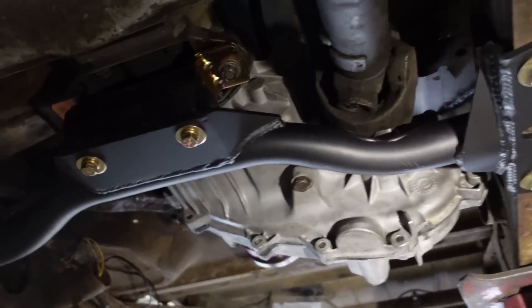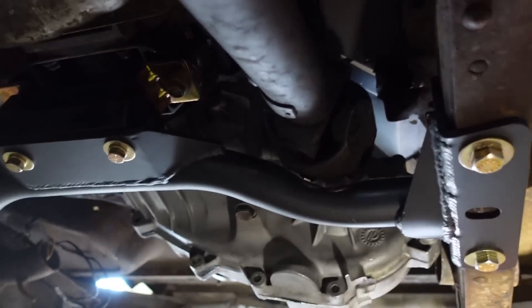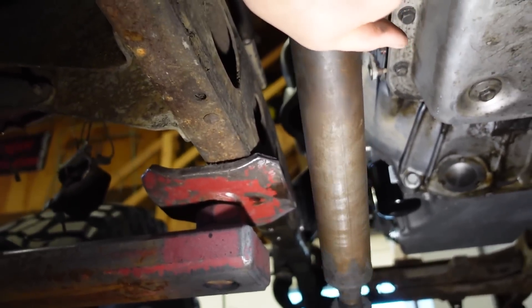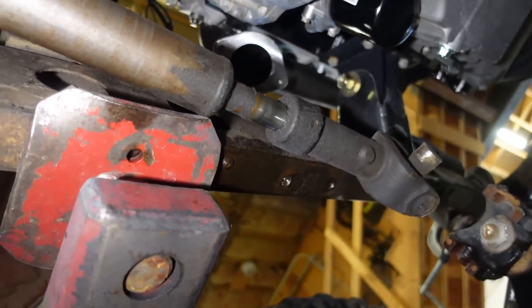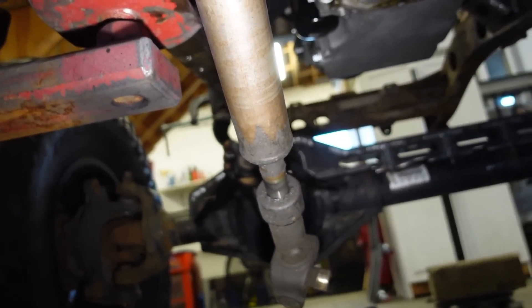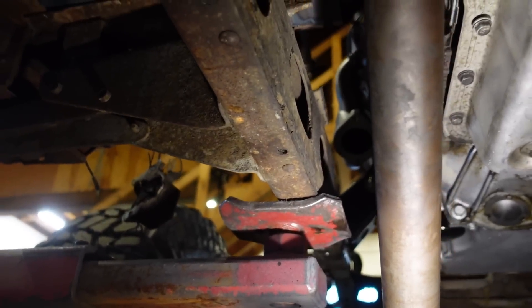We are back together. You can see the crossmember's bolted in — we've got about a half inch of clearance when the driveline is completely at its max down. When I lift it up to where it actually would be, we've got even more clearance. So that is definitely going to work. As far as the driveline frame issue, this does seem to help out. Should be about straight connected. We've got probably closer to three-quarters to an inch of gap. I do want to jump this up in wall thickness — probably go quarter wall or 3/16ths — but that is going to be a bigger outside diameter, so it'll be a little bit closer to the frame, probably only about an eighth inch on each side. So we should still have plenty of clearance.